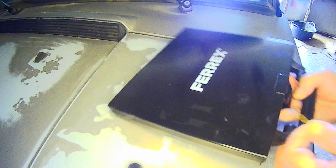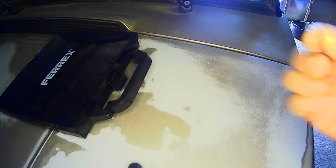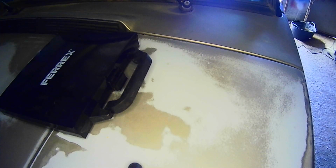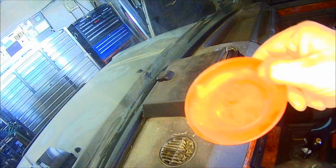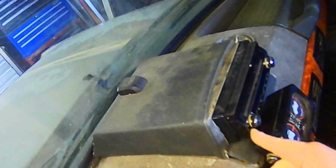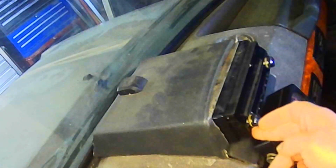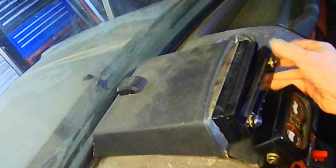So leave that there, and I'll see if I can find a pin to match this 1.5 mil drill. If so, this is the one I'll use. Right, I've got four little tiny pins cut. They're in my little magnetic tray there. And what I'm going to try and do, that should push in. And it does. It pushes in at the bottom. So I think maybe I can just get away with a pin at the bottom and one at the other side.